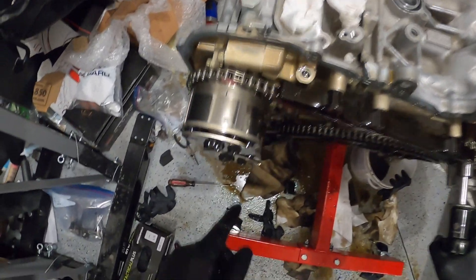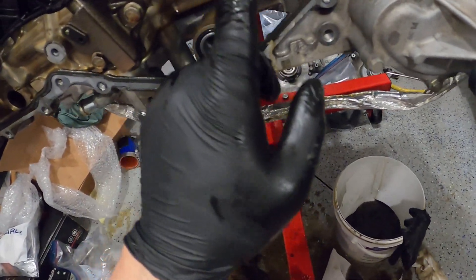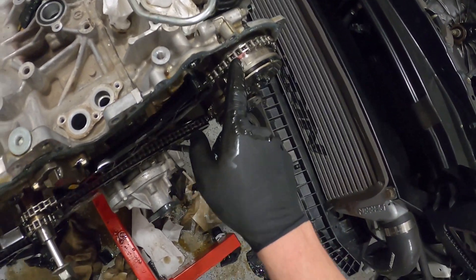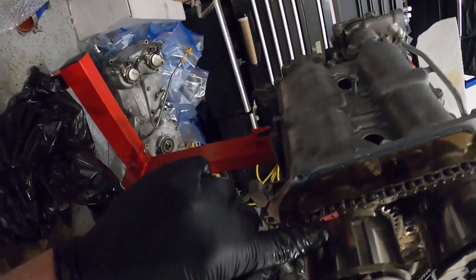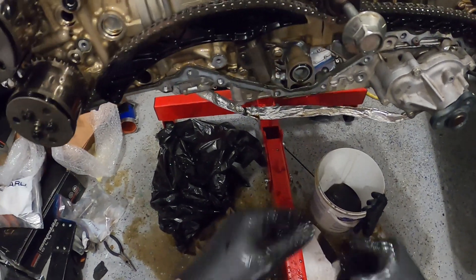Boom — pink on pink, facing, or pink on line, pink on line. Gray is slightly off-centered, keyway is on the bottom. Boom, all the alignment matches up. So if you're getting issues where it doesn't seem right, this is exactly correct now. Dash mark on the cam lines with pink. Gray or black link is slightly like 10% off. The keyway is 100% facing 90 degrees down, and the dash mark there is aligned with the pink. Arrows facing each other. Boom. We have exact timing.